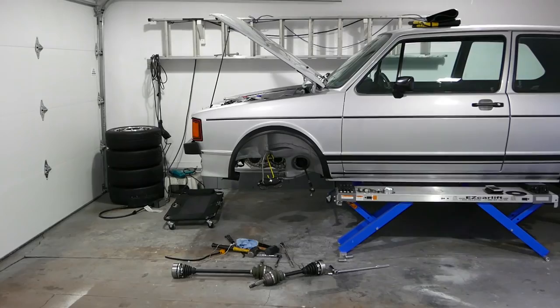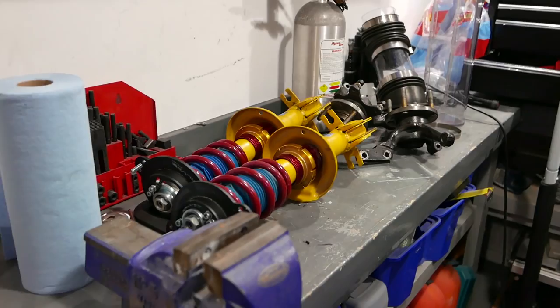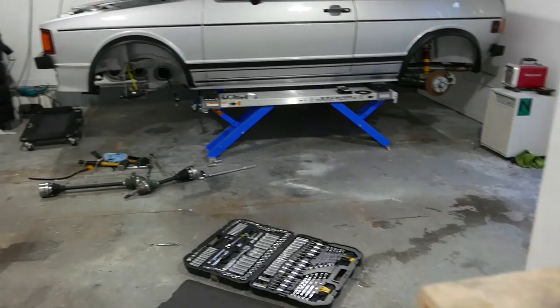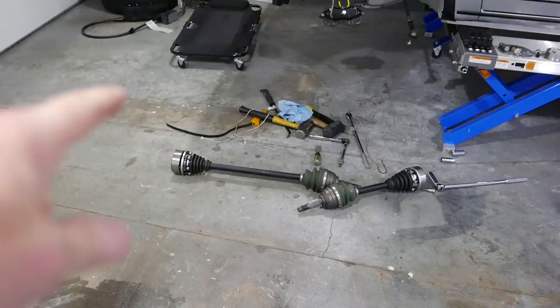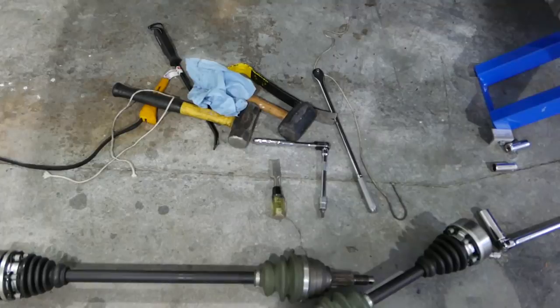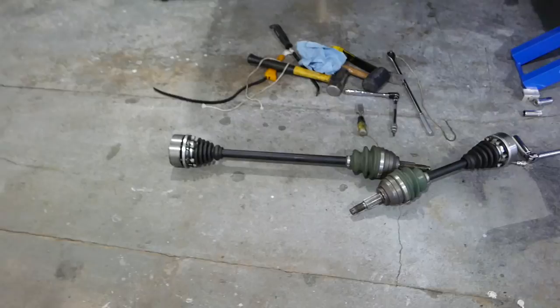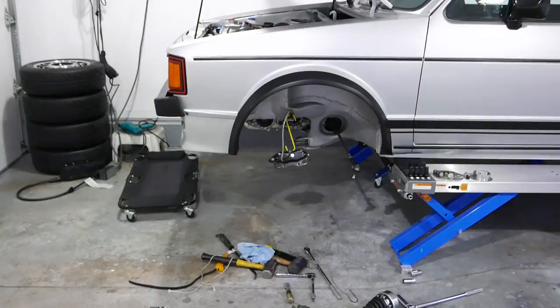The control arms, brakes, suspension, and axles are all pulled out and piled up — a good bit of work for the afternoon. The ball joints going into the knuckles had to be pounded out — a little rusty, needed some PB Blaster. Same thing with the inner CV joints, which sometimes stick to the cups in the transmission differential. I ultimately had to use a chisel with a larger hammer to grab the edge of the flange and knock them out. The stress bars are out too, so making good progress.